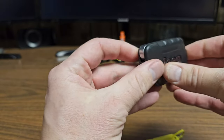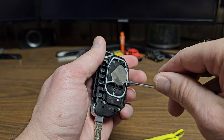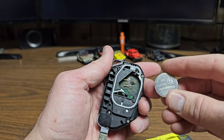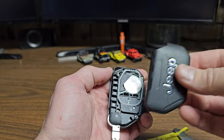Just put the knife in the notch and twist it open like so, and it just pops open. You can open the key portion to make this a little bit easier to handle. Once it's off, take your flathead screwdriver, put it in there, and the battery pops right out. When you put the new one in, make sure the plus side is up, put it in like so, and snap it in.